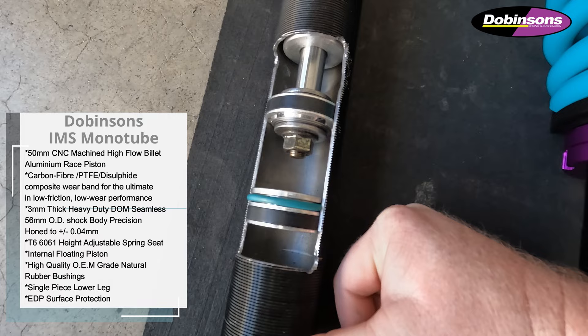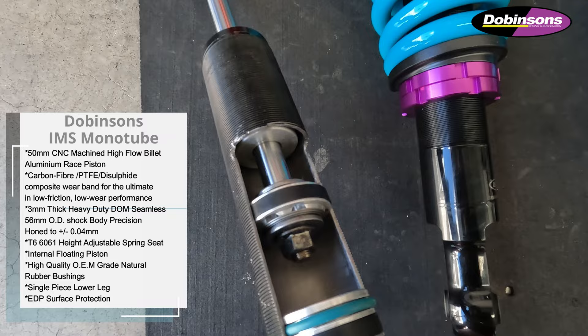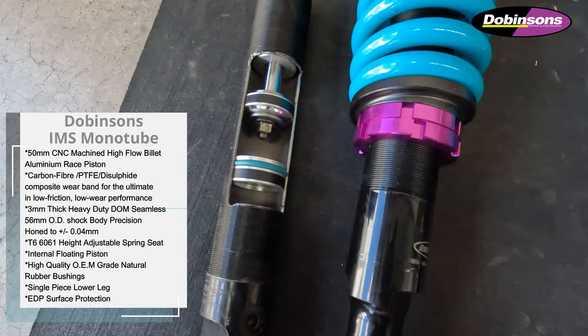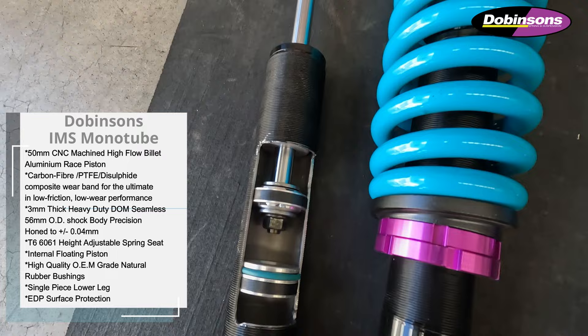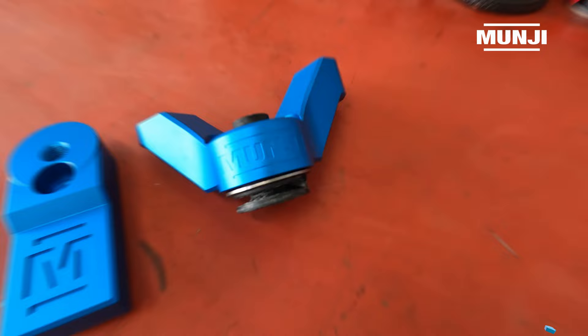What they do is set the shims according to the vehicle — each vehicle has specific valving. So basically they can choose how they want it. Compared to your standard style shock, this one's going to be able to handle the big bumps a lot better. Whereas your standard one's going to just blow through the bumps on big hits, these ones are going to handle a lot more. They do stay cooler as well because they're a mono tube design. We've been doing these a long time in the D-Max now and they work really well.